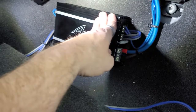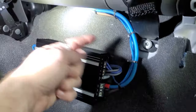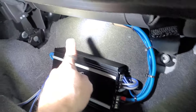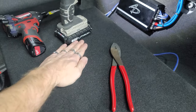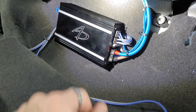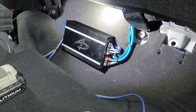We've got our AD amp installed in here right now — four screws in, speaker wires ran underneath. Everything else is ran up behind and into position. We've got our ground connected underneath, and all the other wiring is running back through. Speaker wires are ran to the back of the speaker terminals on the enclosure. It's a very simple setup: ground, remote, power, speaker wires, RCA, and bass cable.